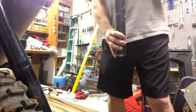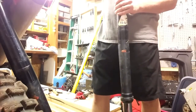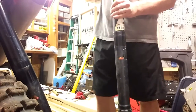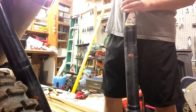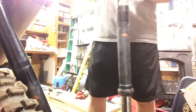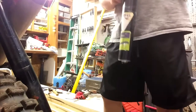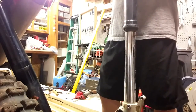So let me turn it up. Still some gurgling sound. And let me bleed this one again. A little bit. Nothing major. Let's turn it over, do it again. Still some gurgling, I can feel air bubbles moving through there. Bleed that off again.